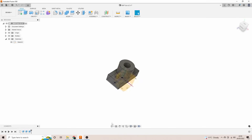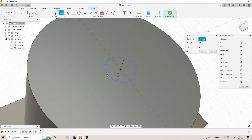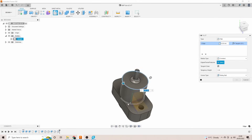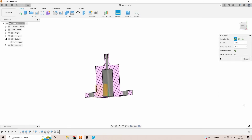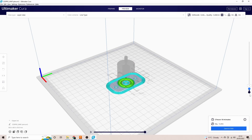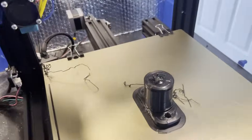We've got lots of inlets and outlets, so we're going to redo this whole piece and make it a lot smaller, with only one inlet. We'll have to combine all of the vacuum hoses from each of the runners into a single line - that's currently how I do it on the mini and I get a nice stable signal from that. So I sent the file to the printer, waited four hours, and came back to find it had failed.